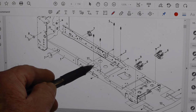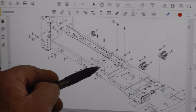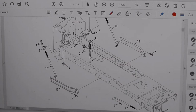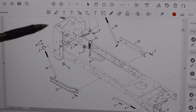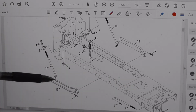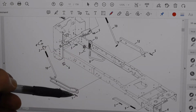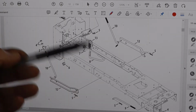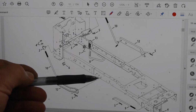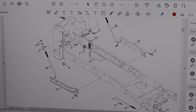Naturally, this is your belt tensioner assembly, fits on top of there. Okay, here's the frame again. Same thing, engine, transmission. Here's the levers I was talking about that goes on the pin. Each side just has a little clip. Pull the clip out, drop it down. No springs to worry about, no tensions, any of that stuff, and you'll have free access to the 3 bolts on each side.